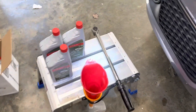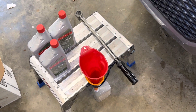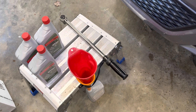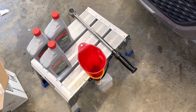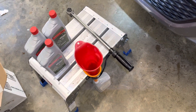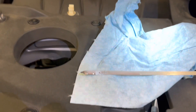Drain the fluid out, then add 3.3 quarts using your two long skinny funnels angled into the dipstick hole. Drive the car around for 10 minutes, drain again, add 3.3 quarts, drive for 10 minutes, drain again, and fill it up one more time with 3.3 quarts. That's the full three-cycle drain-and-fill procedure.